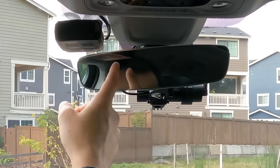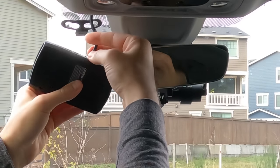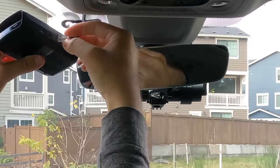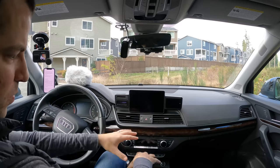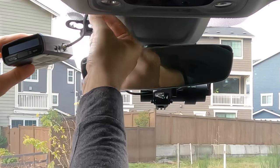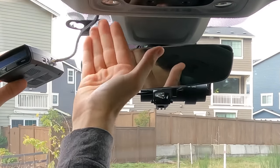Starting off, let's begin with the radar detector. I've got my radar detector up here hardwired and something that I notice a lot is sometimes the suction cup will fail and the radar detector will actually fall off the windshield. One of the issues that I've had is that this locking tab right here, it broke off before. So if my radar detector would actually fall off the windshield, it wouldn't lock into place and it would just fall off and I would come back to the car with the detector hanging or laying on the ground. For that reason, I just had them recrimp the connector here plus adjust the length, and there's a little bit more slack in the cable now.